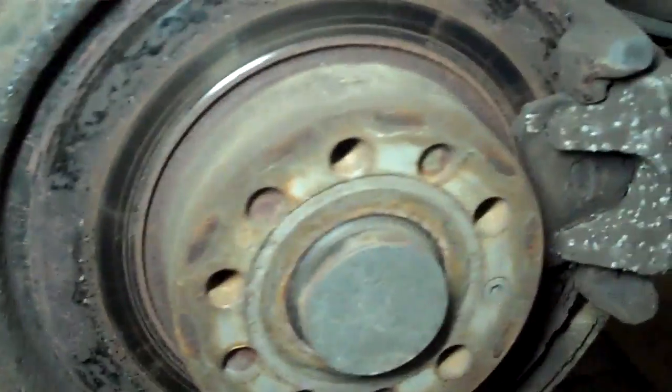Now it's the final clip with a VW Golf 1.9 TDI and we are going to do a job on the brakes. You can see where the brakes are badly rusted, badly corroded, and the wheels jammed on. We will take the brake caliper apart, clean it, and free it out.